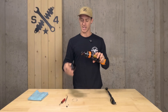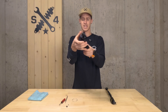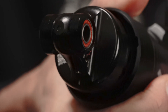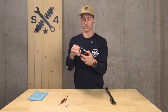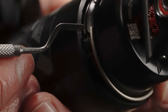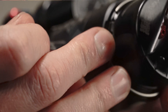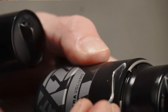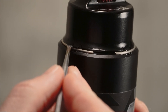Now your volume spacers are in, and you need to slide your air sleeve back on. Get it halfway on, then check your orientation to make sure everything is set properly. On the X2, there are little feet — the same ones that hold the C-clip in — that you need to line up before you can slide the air sleeve back on. Once lined up, it should just pop right back into place. Then put in the retention system, which is simply the C-clip. To reinstall it, note the location of the two feet, go to the outer edge of one, slide the C-clip into place, and push it around in that groove all the way past the second foot. Then center the opening in the C-clip between those two feet — that's what creates the safety seal once you pressurize the shock.